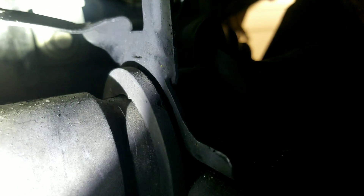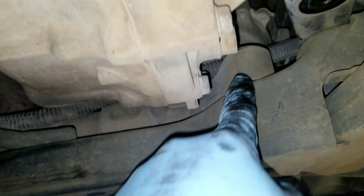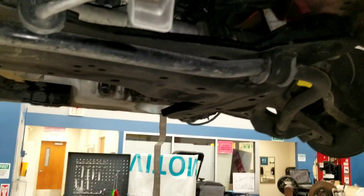Helps if you have a lift. Here's the bracket for the rack — this one — and there's one on the other side, another bolt on the other side. Here's the rack, there's a bracket holding it up to the subframe. Take that one loose, take that one out, take those completely out so that your rack can stay up. Here's a better angle of the top one — goes on to the subframe — and you're gonna loosen one, two. This is on the back of the engine.